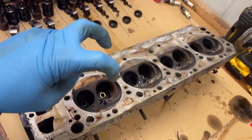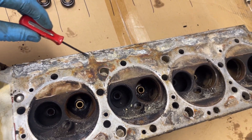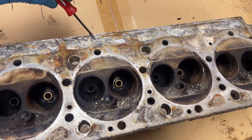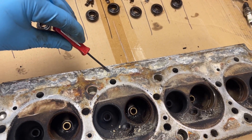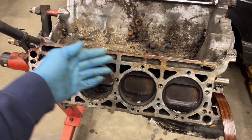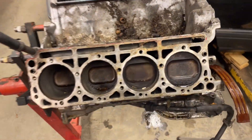Going through my new head over here — there's a major issue with this pitting where the coolant was. I don't know if they were just using straight water in this engine, but clearly there's major pitting here, about an eighth to a sixteenth of an inch recess right there. Where this part of the head sits on the block, the head gasket covers this area, forcing water to go from one side to the other underneath the head gasket. But now since it's not completely flat, it's going to be pushing up a little bit — so it may or may not be a problem.